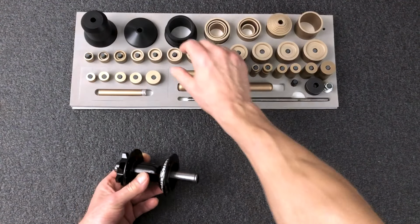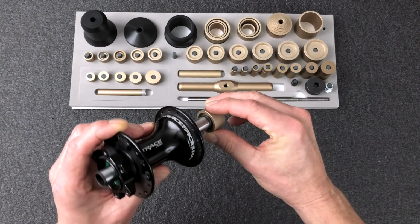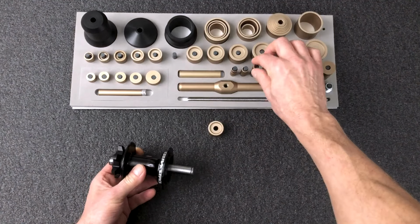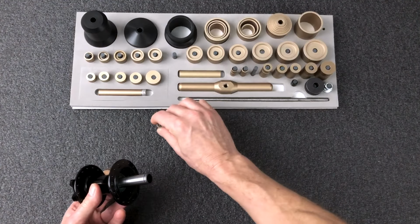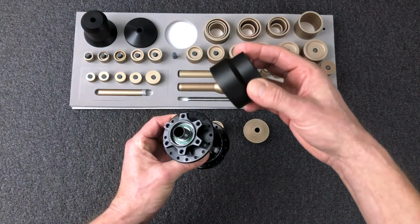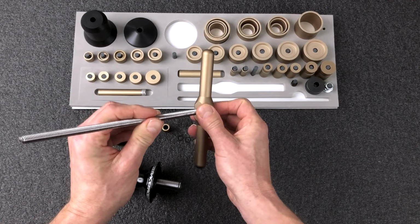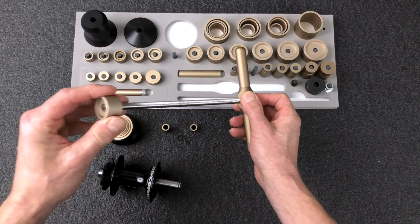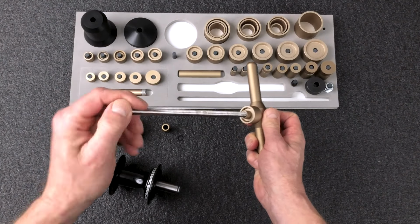Here's how you press out the first bearing in the common variation. Choose a drift or a large pilot to press on the end of the axle. Then choose pilots to center inside the axle, but we're going to need it for both ends. Then choose a suitable leverage piece that has clearance for when the axle moves. Now to assemble the tool, install the pressing piece, then the small pilot, and use an O-ring to hold the pilot in place.